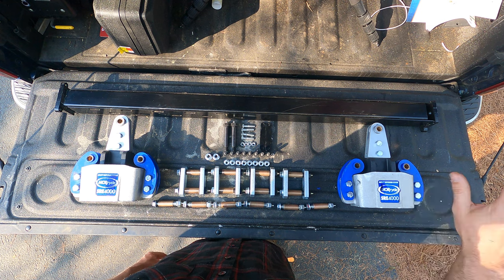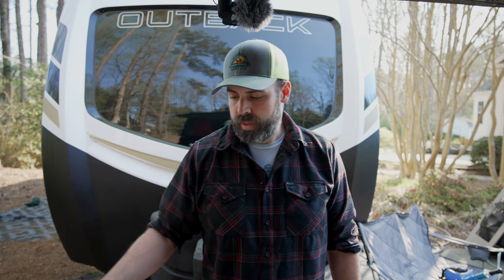If you put them side by side there is a good size difference, so there are places where you'll want to use one over the other. This one does add about an inch to an inch and a half of height to your trailer. So if you're already in that 13'6" range like the tall fifth wheels, this probably wouldn't be the kit you'd want, because you'd be going into the 13'7" range. With most DOT regulations, you want to be at 13'6" or under — after that you're over height. Always measure your air conditioners, because the last thing you want is to approach a bridge unsure if you'll fit. Ten minutes of measuring can save you thousands in repairs.